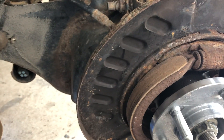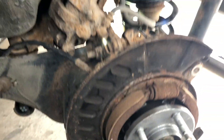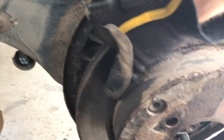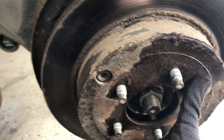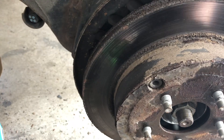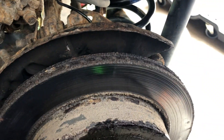We've got the two nuts on. We put some anti-seize around there - you can see it's quite rusty. We're going to be doing the rear brakes a little bit later, but for now we're just going to drop the rotor on. Here's our rotor - we just line it up just like this, then wiggle it for the emergency brake shoes that are in there just to center them, and the rotor will pop on.